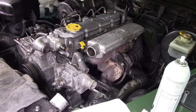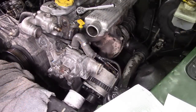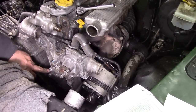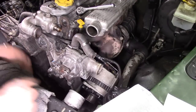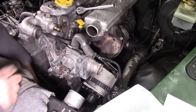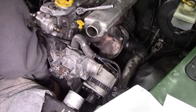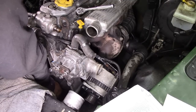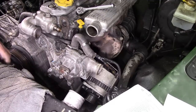Next thing we're going to do, it's just like I say in the Haynes manual, it's the reverse of taking it all to bits. Once we've got this water pump and everything's tightened up and torqued down properly, we're not going to forget the bottom bolt. There's two bolts that go in at the bottom. One's a nut and one's a bolt. That's, you know, the tricky one I had a job trying to get out. They're both 25 Newton meters, so it's not a big deal, but that's that one in. We'll find the nut.